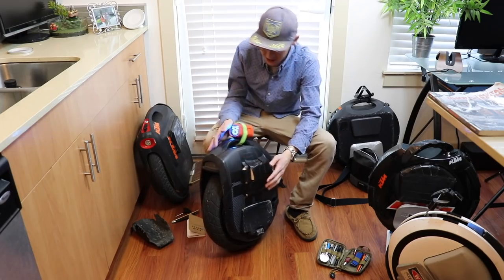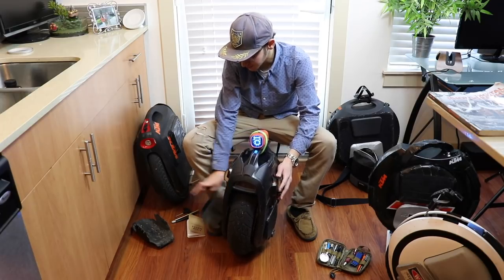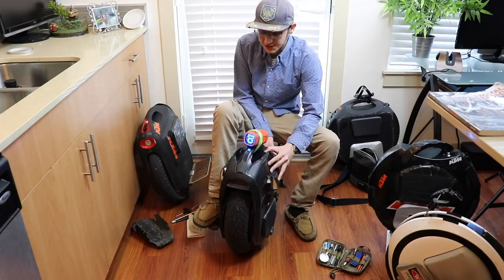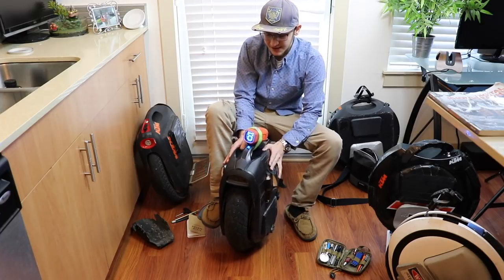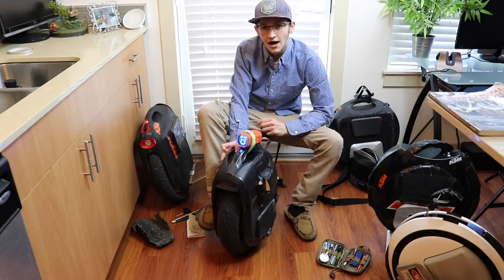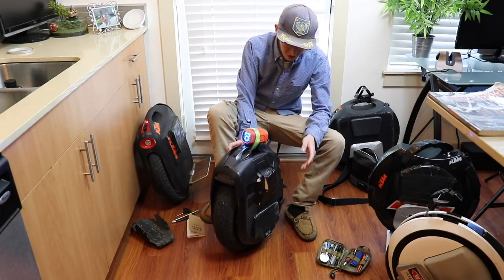In the second video I put out, I was getting speed wobbles. What was happening is you have such a wide stance on this thing, your feet are out like this, and there's so much weight at the top. Tire pressure was a huge thing too — you hit one bump with that high tire pressure combined with not much side cushioning, and you'd get that oscillation back and forth at high speeds. I was able to completely solve that by putting these side pads on and taking some air out of the tire. I'm able to go 30 comfortably everywhere now, absolutely no speed wobbles on deceleration, acceleration, or anything like that.